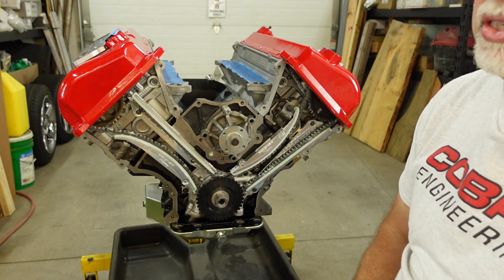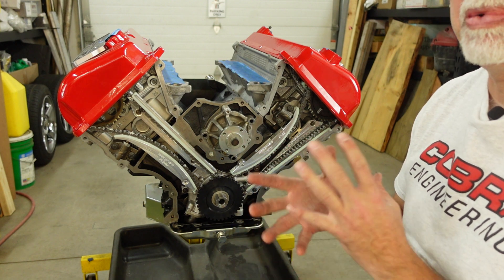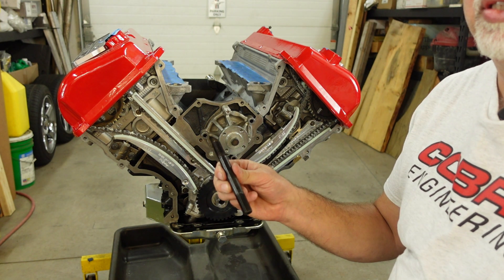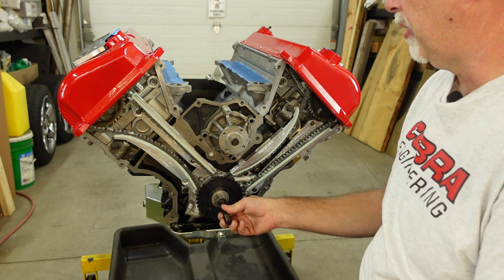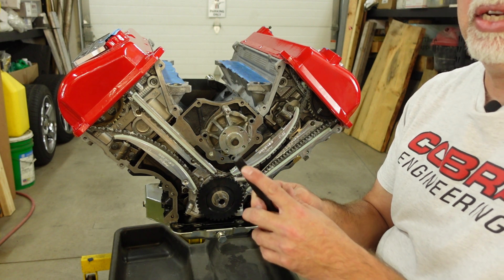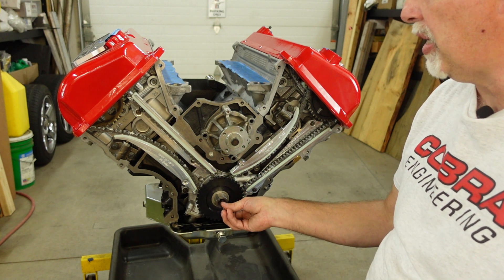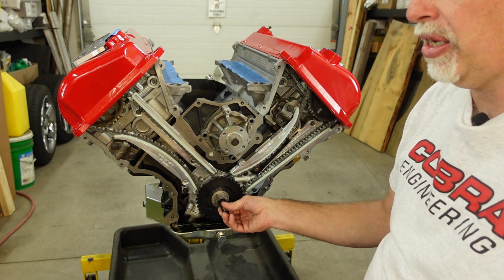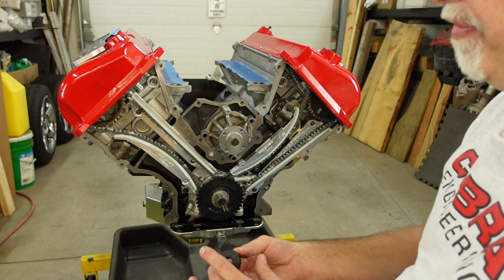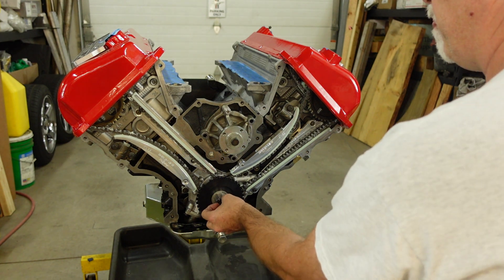In theory, with these washers you almost don't even need a key. They're basically diamond impregnated — think of it as sandpaper between the two. You're not going to be able to rotate that. Of course, with the added torque of a 9/16" stud going in there, as we previously showed. Put a little thread sealer on here in case you broke through into the oil main on the crank. Not a big deal — just make sure there's no chips or anything that's going to get in your oil system. Thread seal that, and of course you're going to use a little RTV on the back of the washer and the nut when you put it on, because that's what's going to keep oil from weeping through your system.